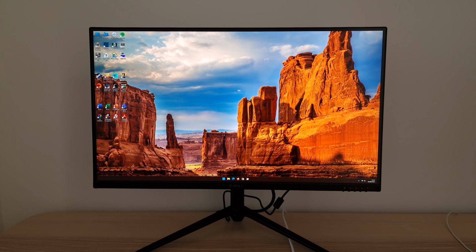Just a solid all-round performance, really. Good level of responsiveness. The contrast is decent for the panel type. Not amazing, but not terrible either. Good vibrant color output. It would have been nice to have an sRGB emulation mode, so that is something that's missing. The maximum brightness isn't super high, but it's actually not terrible either, and I recorded 293 nits maximum, just a little bit shy of 300 nits, so that actually exceeds the specified 250. This is actually plenty for most people.